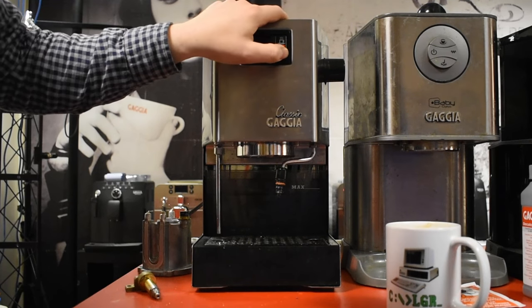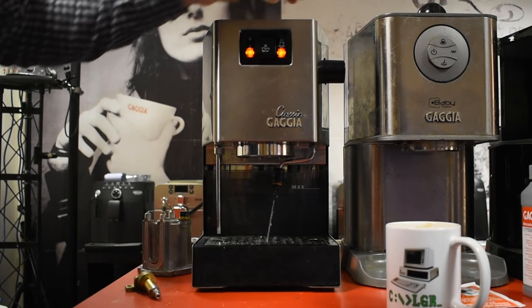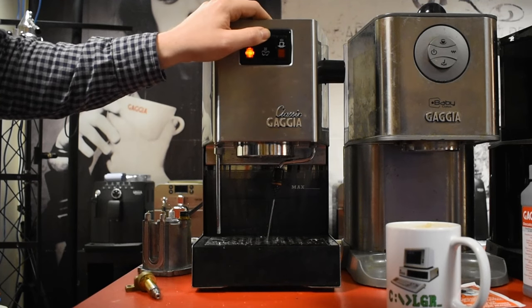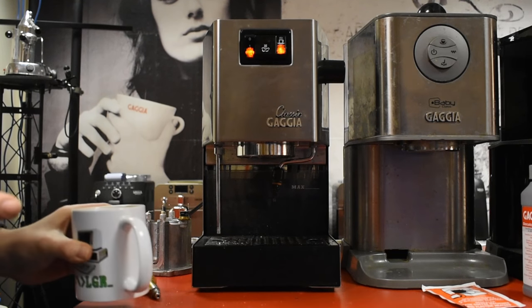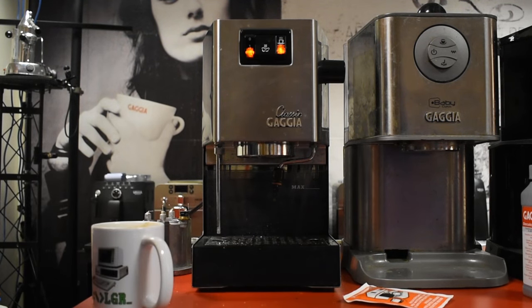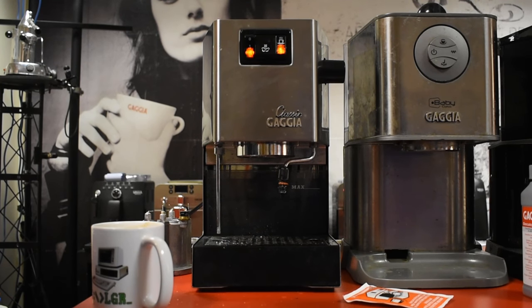We're going to open the steam valve, we're going to turn on the coffee button, and then we're going to turn the steam button on and off. What that does is it moves that piece of metal backwards and forwards inside the valve, and you're hoping for either the scale to be broken apart or for the scale to be slightly dissolved. You may find that you need to do that two or three times and run the cycle two or three times before you see any effect. It is a gradual process, so it will start to work a little bit, and you'll see little drips coming out of your brew head, and then more and more. You will know that you're on the right track if you start to see those little drips come out of your brew head.